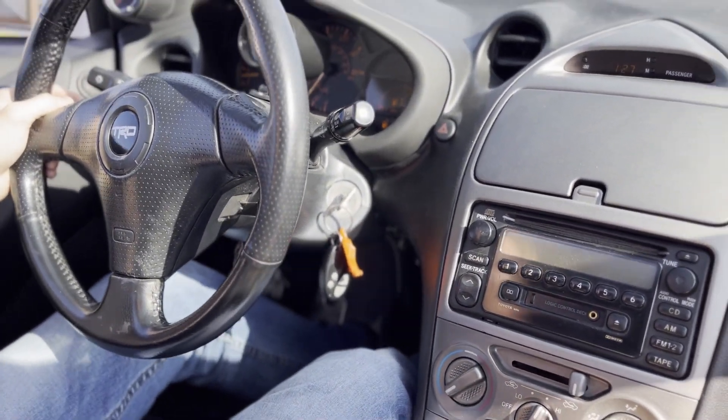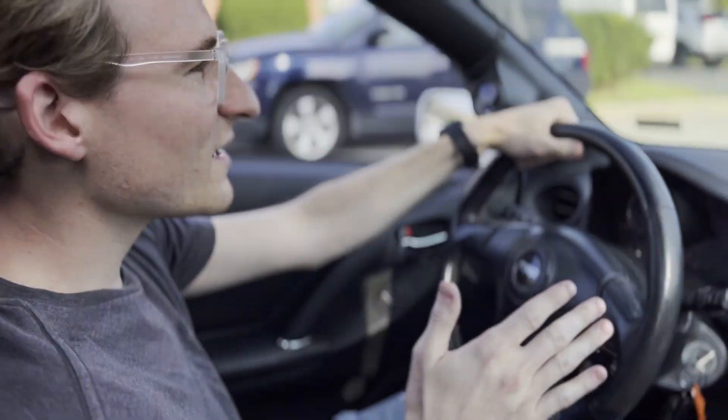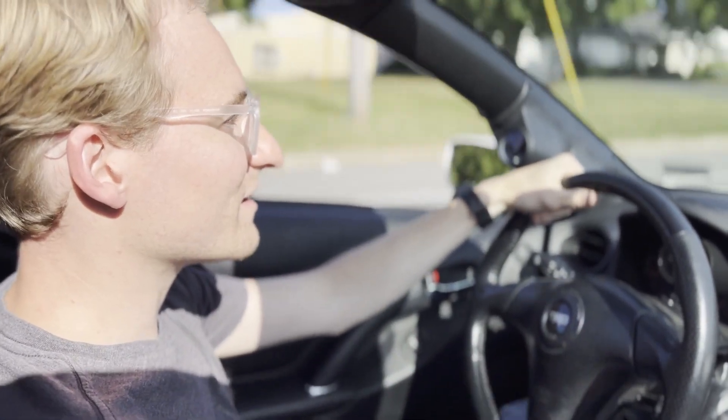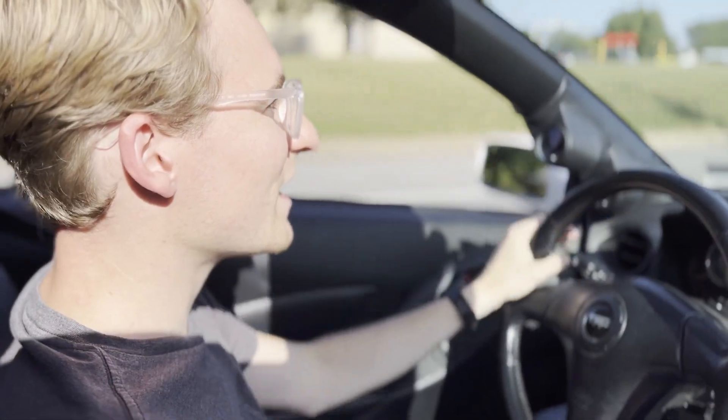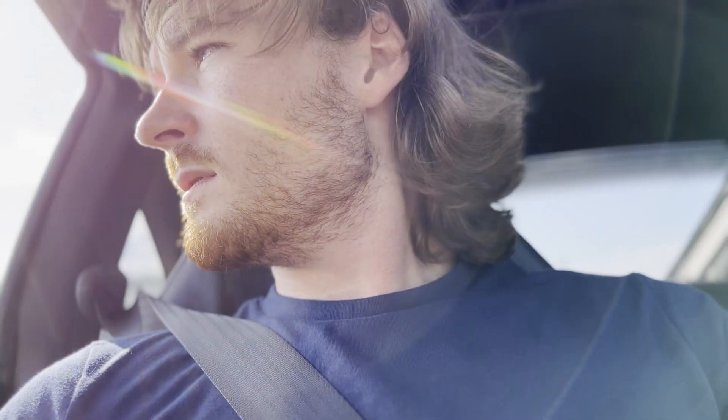Is it not warmed up? Oh no, I'm just not past my throttle position. I have the throttle position set high enough where I can stay off the supercharger if I want to, but low enough where if I want to get on it, it's not too high up in my throttle position. So that's one thing you can do with the clutch pulley, which I won't be able to do on the MR2 until I find a clutch pulley that works. Right now all I have is the fixed pulley, which based on my measurements should be perfect to make eight to ten pounds of boost.